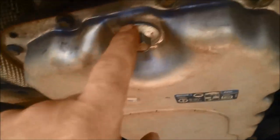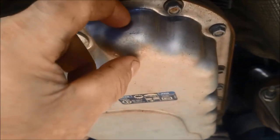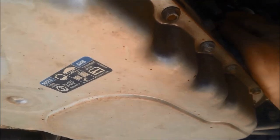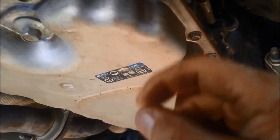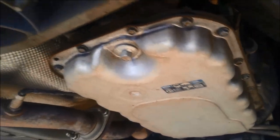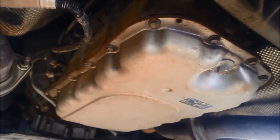When you drain the oil out you won't get all the oil out — there'll be some left in there. To fill it, you've got a fill plug on the driver's side or the right-hand side of the transmission. There's a little cap that you need to unlock or push up, and then you'll be able to slide that little filler plug out. We'll just start off with cleaning around where the pan gasket or pan seal is.